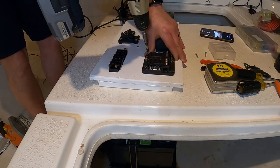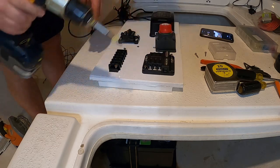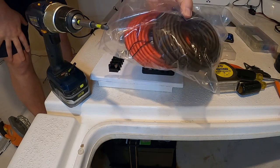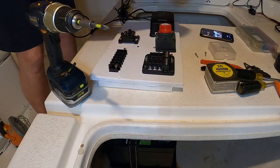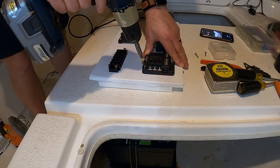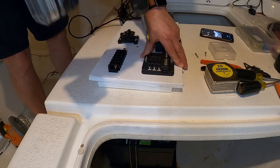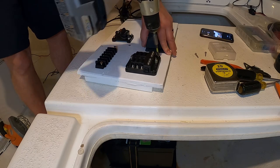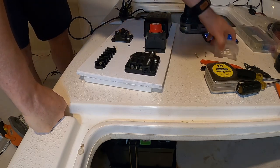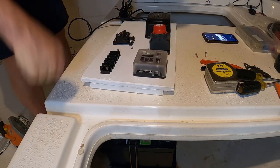We're going to make this thing look good. I've got stainless steel screws for everything and there'll be links to everything in the description. I'm going to take my screwdriver and my drill, start putting the screws to it, and then we're going to mount it in the boat with some adhesive and a couple of screws. We'll let it dry overnight and then tomorrow I will come down and start wiring the boat up. I have marine grade wire, terminals with heat shrink tubing, a heat gun, and we're going to put this thing together just like it's supposed to be.